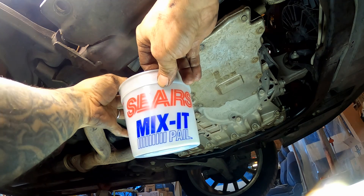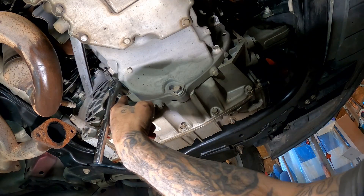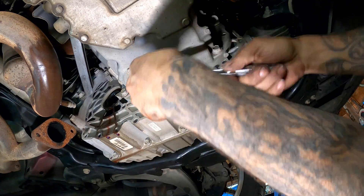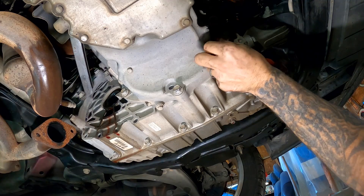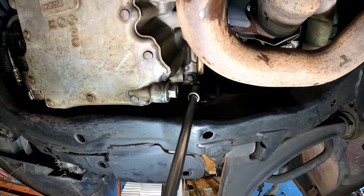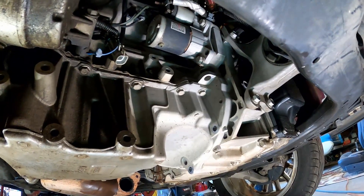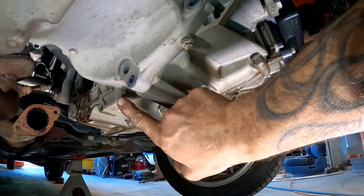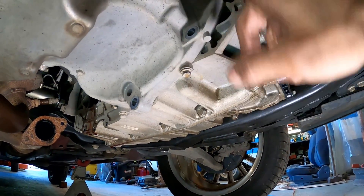The oil looks pretty dirty. Across the back of the pan we've got three bolts - they're 15mm - those hook to the transmission. We'll get those out. The rest of them face upward and are 13mm. We're down to the last one on this side. There were five on the other side and looks like six on this side. I'm also noticing these two little guys, one on each side - it might have something to do with the rear seal. Let's go ahead and get these other six bolts out.